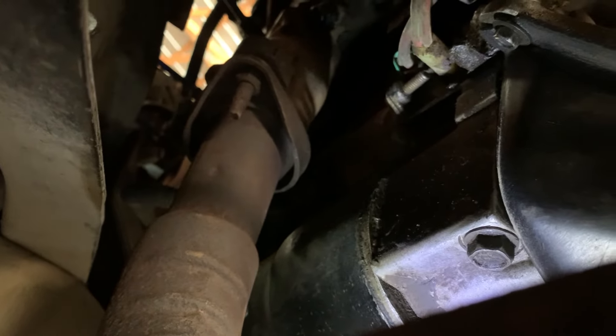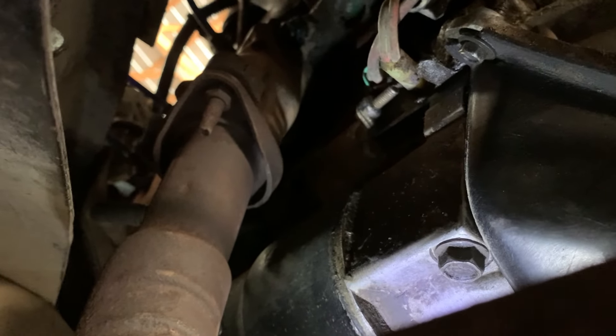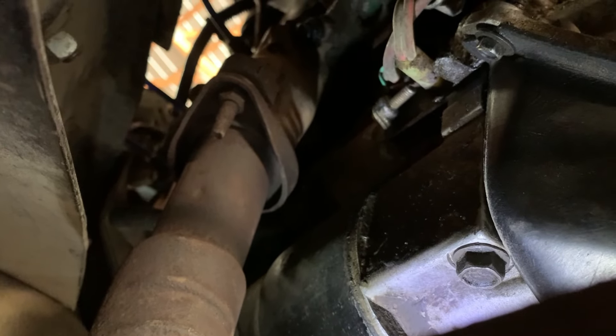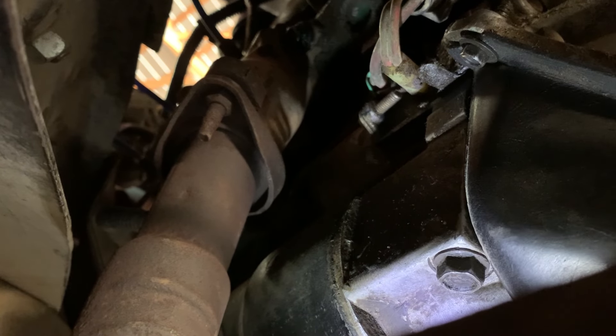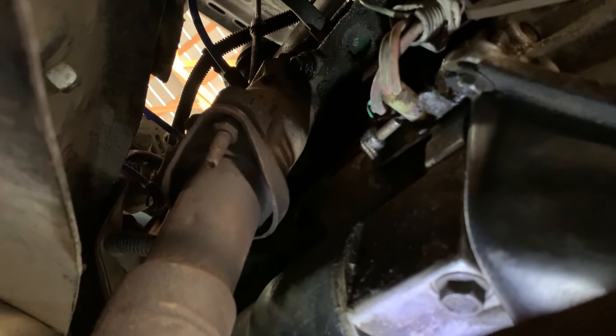Here I am in one of my favorite spots — sarcasm intended. That's the starter on the old 403. As far as I can see, everything looks normal on the outside; the bolts are super tight. I'm thinking the trouble is inside — starter drive probably got jammed up against the ring gear flex plate and destruction ensued. What a place to work. As thin as I am I can still barely fit underneath this thing without jacking it up, so I'll leave that for another day.